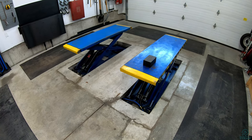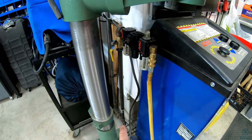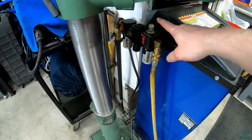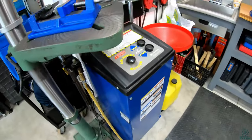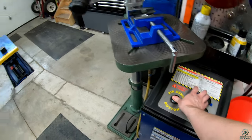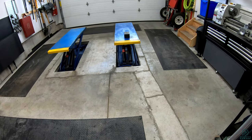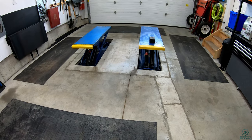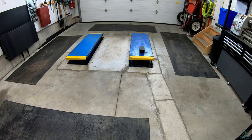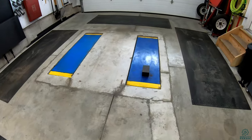To feed the air for the locks I have a little offshoot from my airlines that goes through a filter regulator and a lubricator and then down into the lift — that's what actually operates the locks. When you want to lower the lift you raise it up a little bit, hit the lock release — you can hear that — and then let the lift down while holding that in. Without weight on it it takes a while, but once past the lock you can let go and it falls down the rest of the way into the floor.